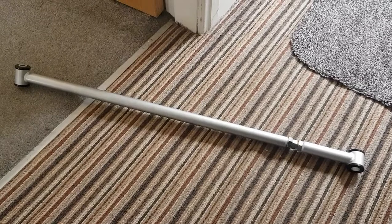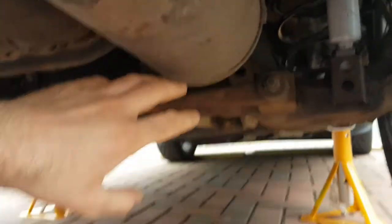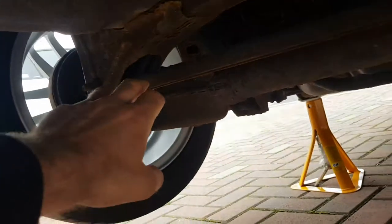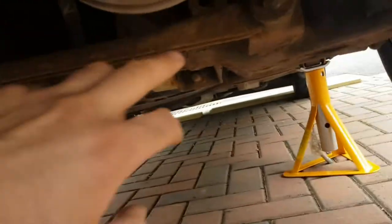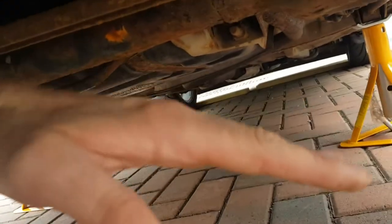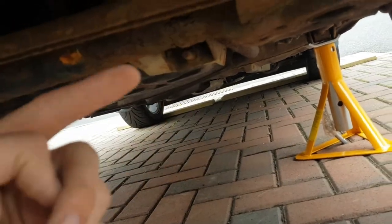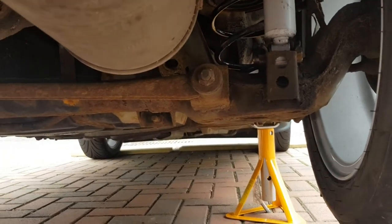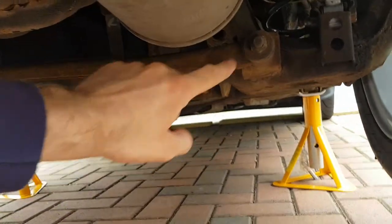That's what we're going to do today - I'm going to whip it on now and hopefully get it into the track this afternoon so I can take it on track tomorrow. This here is the standard bar. It mounts on the chassis and on the axle, and as it pivots up the point of connection moves, which in turn moves the whole axle to the side.